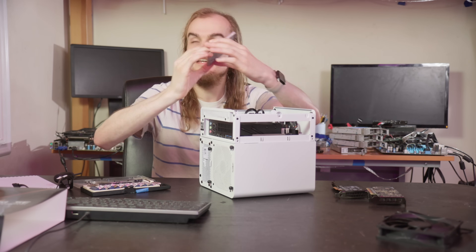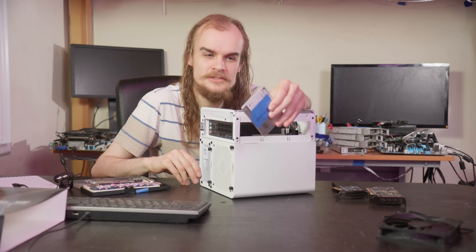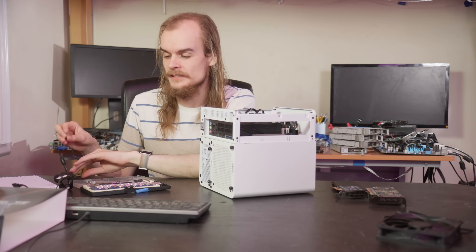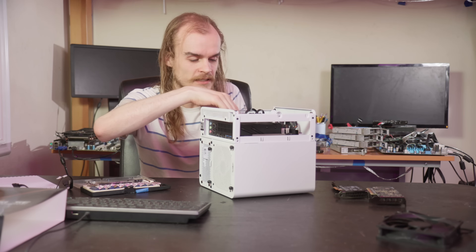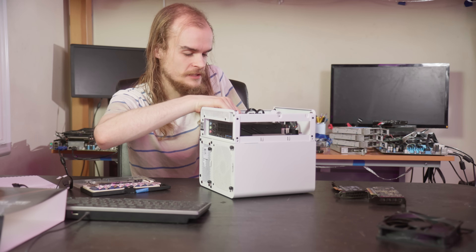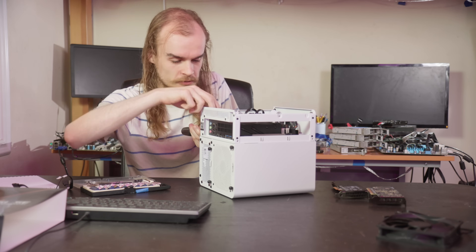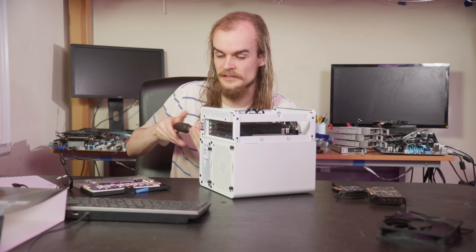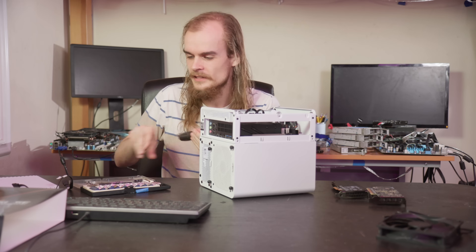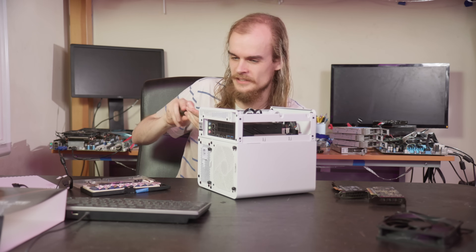That leaves me with a 2.5-inch SATA drive — an Intel S3700 I got a while ago. These are pretty old drives now, but they're SATA SSDs with essentially near-unlimited write endurance, rated for close to 10 write cycles per day. That makes it nice for something like a log drive, especially since it has cache on it. Redundancy is nice for a log drive but it's probably fine to have just one for home server use. You could also use it as a cache drive or VM drive, though at only 200GB it's a little small for VMs.